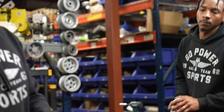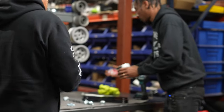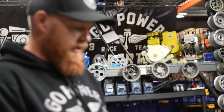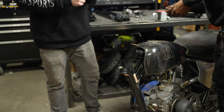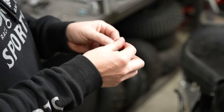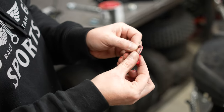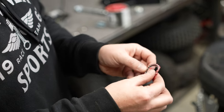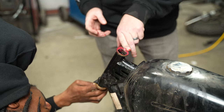These are the bearings you'll receive in the kit — they're actually the exact same as the stock ones. Keep your stock ones handy; if they still look really good you might even just use those and keep these as a backup. You want all of these covered in grease — roll the little ball bearings around, make sure they're completely covered. Then you're also going to go ahead and work grease into the race.